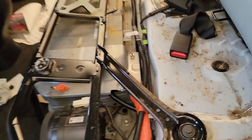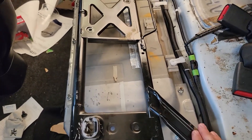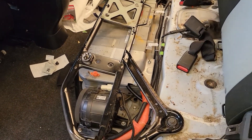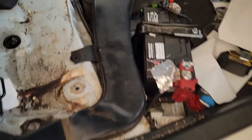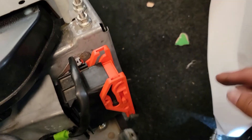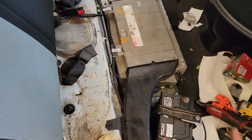After that warning, I'll remove this piece from here — you have one, two, three, four bolts. After you remove this bar, you have access to the battery. My next step will be removing the ground for the battery — very important, we don't want that in the way. We also have to remove the service block. Now that the service block is out, from this point on I'll use my gloves to remove everything.